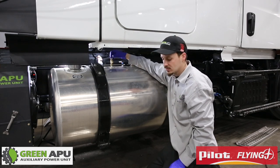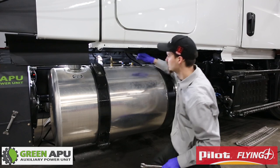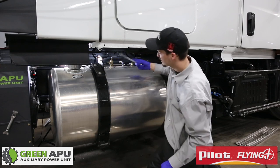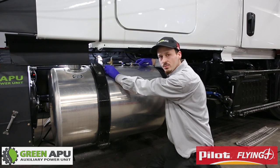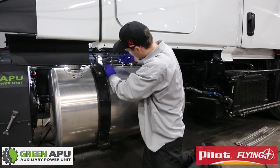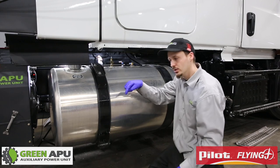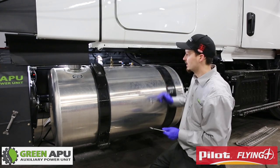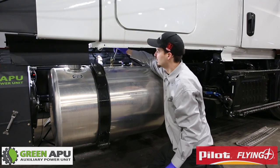To tighten this you're going to need an 18mm, 19mm, a 1/2 inch and a 9/16 to tighten all of it. The 18mm goes around the middle piece — tighten it around just so the bottom gets snug. Once it starts getting tight you can get a little more and it will turn by itself. Don't over-tighten it because you can strip out the threads — this is aluminum so it strips easy. Then have the fuel spout not facing towards the APU but kind of facing away so you can use a little loop when you hook them up to add slack for future maintenance.